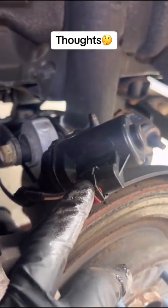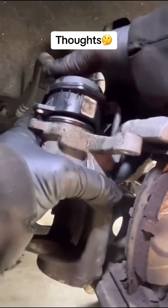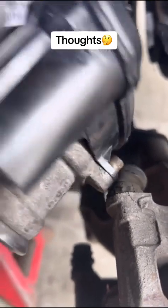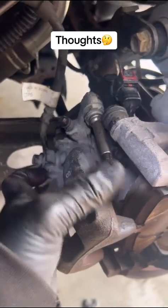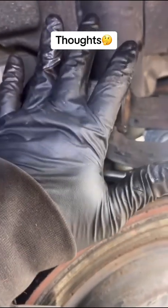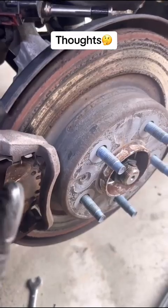It's time to install the parking brake motor back on. Because we have not disconnected this plug, the vehicle knows absolutely nothing about what we're doing. Now we're putting the parking brake motor back on, then putting our bolts back on. Next step is to grease the slide pin. We're going to move the caliper to the side because it's ready to be installed, and now we're going to remove the pad bracket.